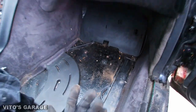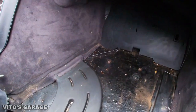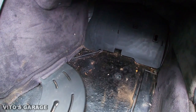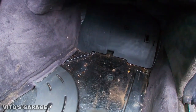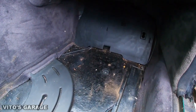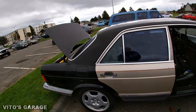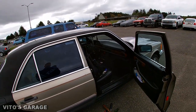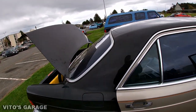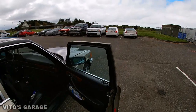I'll show you a really bad case on another car that actually has a lot of rust holes. I had to remove the sound deadening entirely just to see what was underneath because it was actually pretty bad — I'm going to have to do a lot of welding on that car. Another thing to watch out for: if you have an old car, like an old school Benz, make sure to check under your carpets and make sure everything is dry because the seals actually go bad on these cars. There are windshield seals, door seals — they go bad and start leaking water.